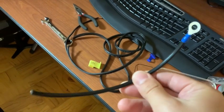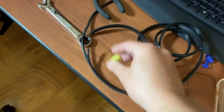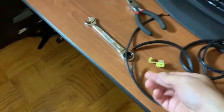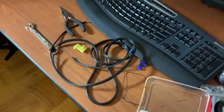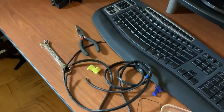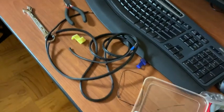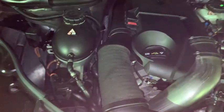So what I was going to do is something like this. I don't think we even need to solder — I think we're just going to crimp this, and I'll need a telephone connector. I'm really not a huge fan of these, but I think it'll be okay because this is just going to ground — it's a ground circuit. I'll put the link in the description below. I was thinking this wasn't worth it, but then I read one person's post that made it so simple, I couldn't not try it.